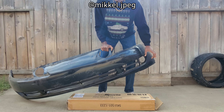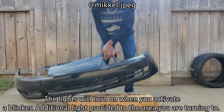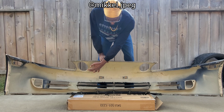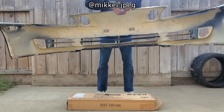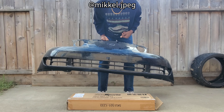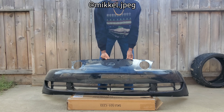As you can see, this doesn't even connect right here — it's not even flush like the newer 95 to 96 would be. Coming over to the side, we do have what's called cornering lights here. You cannot fit the 1995 fog lights in here; these are very shallow compared to the deeper feel of that. The crash bar on the 95 and 96 is the same from the inside — basically the styrofoam bar that goes right here.